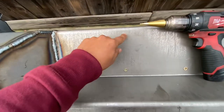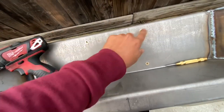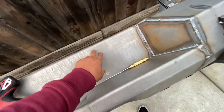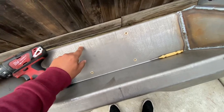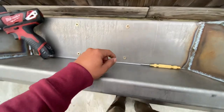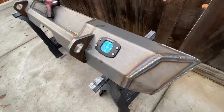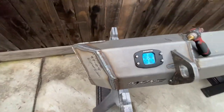As you can see, I also used rib nuts for my license plate mounting — same thing. You drill it out to whatever size is necessary for the rib nut you're going to use; I used M6x1.0, drill it out to 3/8, drop the rib nut in, use the rib nut tool, squeeze it in place, and you're set. Really easy to do — highly recommend it.